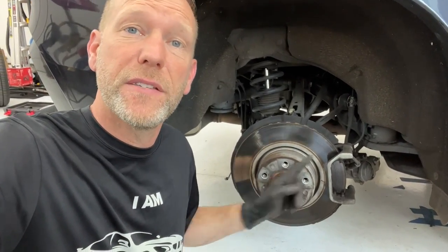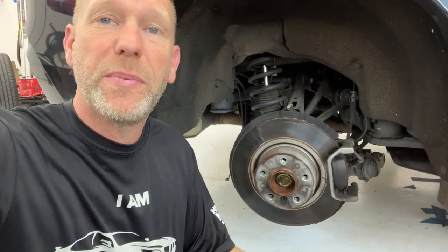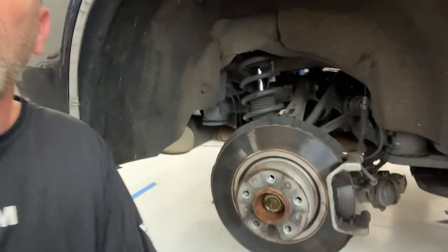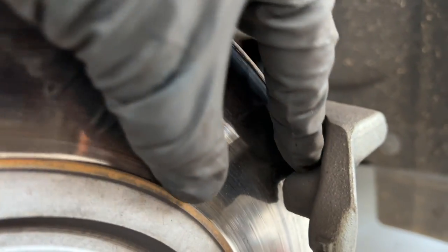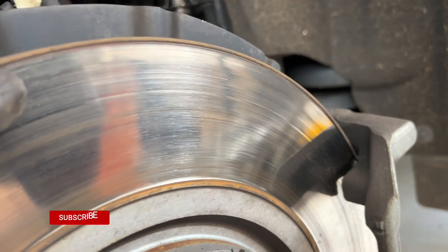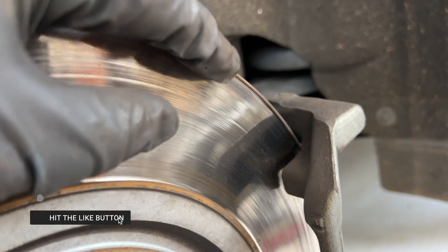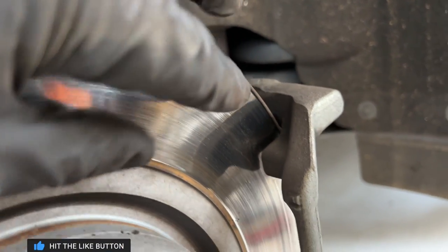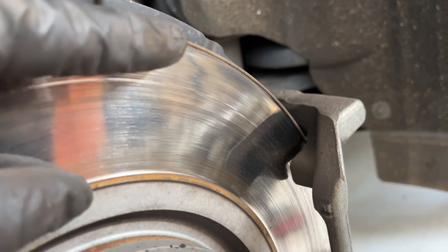After you've gotten this far to do the brake pads, you can do the rotors. You don't always have to do the rotors — people suggest doing them both at the same time. But let me show you why I am doing these. You can see right up here that there is a lip. What that means is the brake pad has been riding around the surface of this rotor, wearing away material on the rotor as well as the brake pad, and that has caused this lip. So if you change your brake pads and you don't have a lip and everything is still smooth, you don't have to change the rotors.